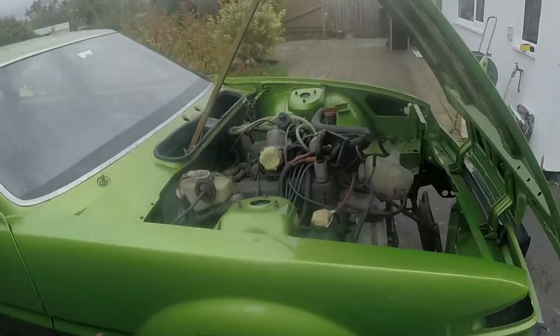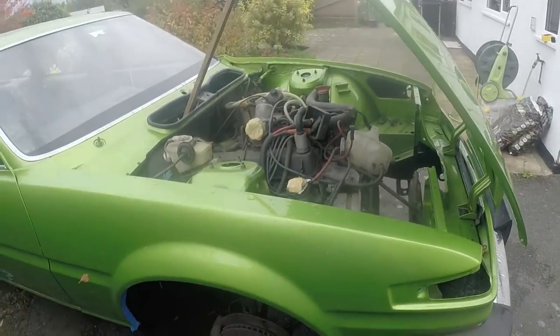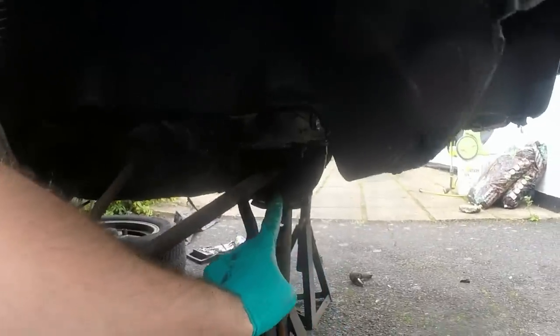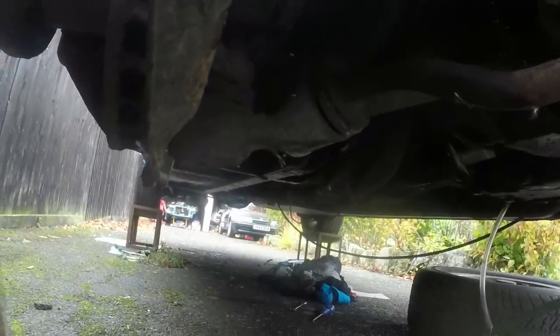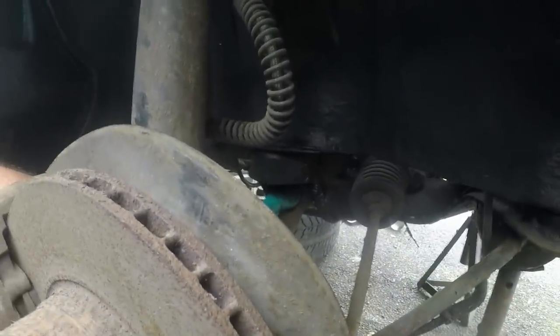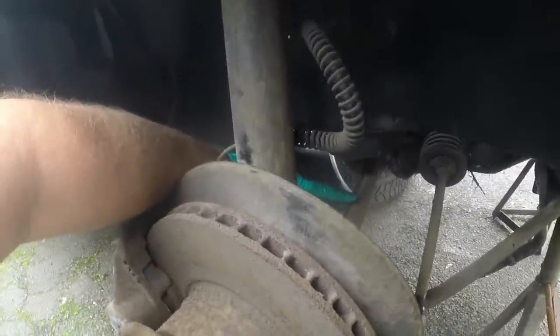The reason I'm talking quickly is because it's about to rain again, so I'm trying to get as much done as I can when the weather allows. I've been all the way through the front suspension, and it's obviously been modified at the front. Anti-roll bar bushes are good. Where it goes into the lower control arm, that's already been fitted with polyurethane bushes. These ones inboard, they're drop-forged steel arm.